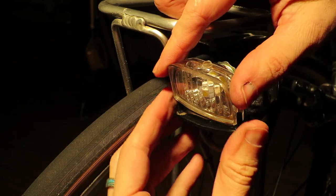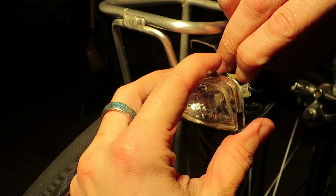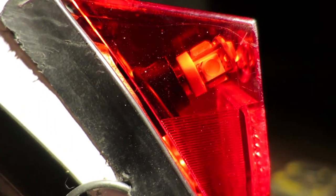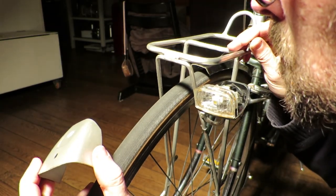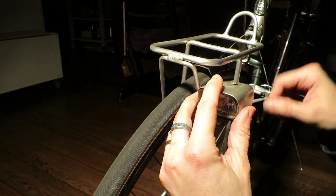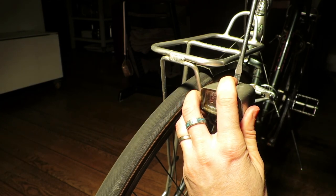The installation process is just as straightforward with LEDs as with normal light bulbs. That being said, because of how they are constructed, the LEDs I bought would prove to be too big to be held in the tiny compartment of the rear light. I doubt you'll ever have this issue with your front lights since they are generally much larger than your rear light. And make sure you point your headlight not straight forward and definitely not in an upwards angle, because the brightness of your LED will blind oncoming traffic, which makes for very dangerous situations.